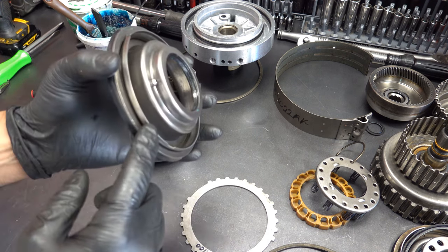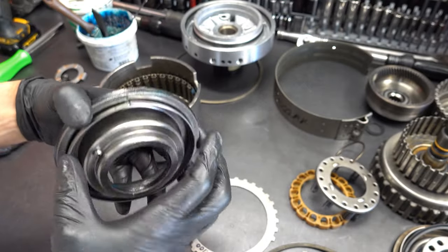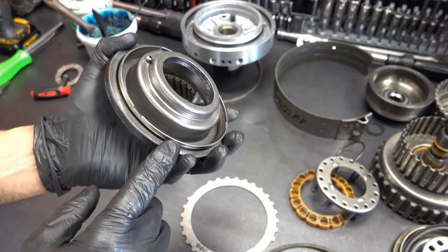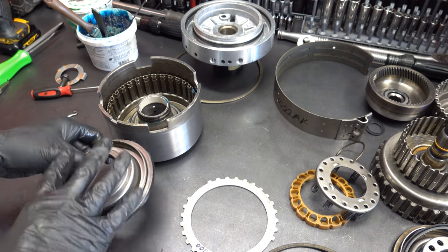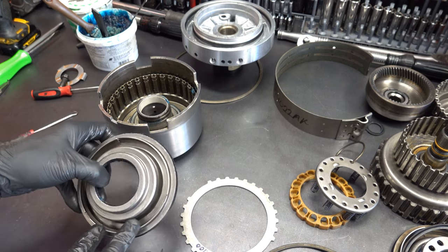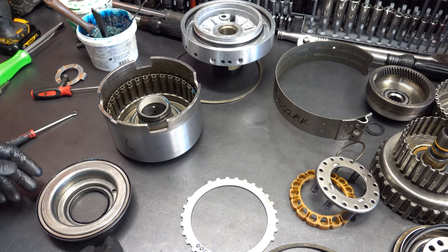Okay, check your apply ring. You want the small side radius installed. This is a 485 thousandths tall ring. The forward drum, which takes one that you can install into this piston if you need to for whatever reason, is 525 thousandths tall.